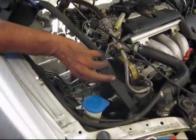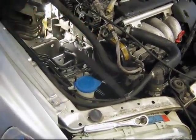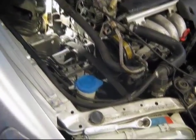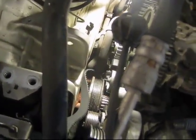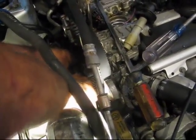We've got the new water pump and tensioner pulley put in. Now throwing in the new belt. This is a good point in the project where you're at risk for swearing — intensely. The trick is getting it on that — I'm slipping it behind the guard here. I think it's in. That's the tricky part. We're all on there and Norm's adjusting the tension on the tensioner. It's a dual adjustment.